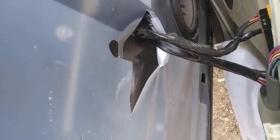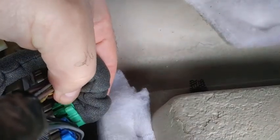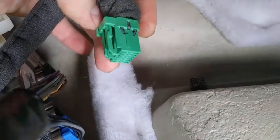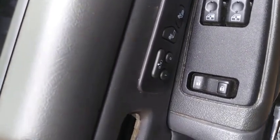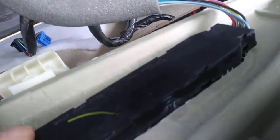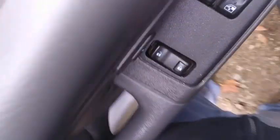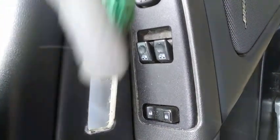Then you got to disconnect your wires if you're going to fool with that. I can leave them connected because all I'm going to do is replace the switch up here, which is right here. Just reach in there and squeeze the little tab in and pull the connector right out. Now that you got the electrical connector unplugged, just reach behind the back side. See the wires on this side hang over the edge, so I'm going to push them to this side, which is on the back edge of the corner. Just push it out and then remove it.